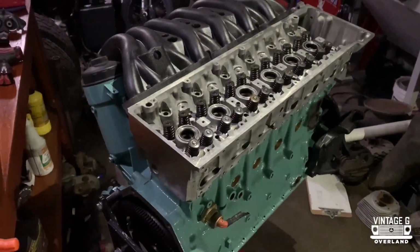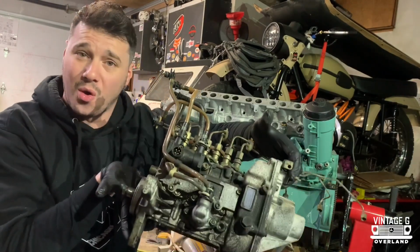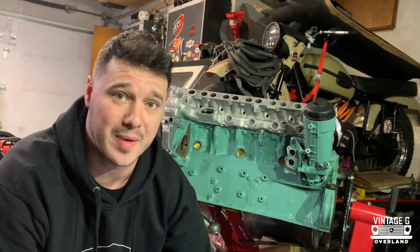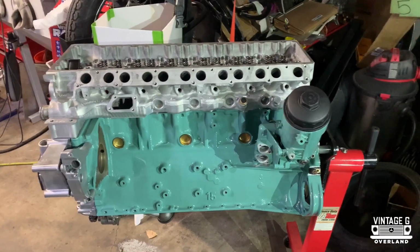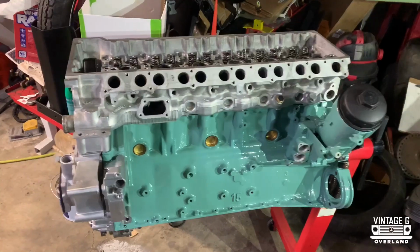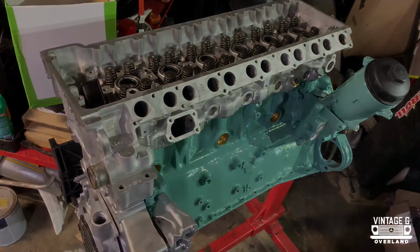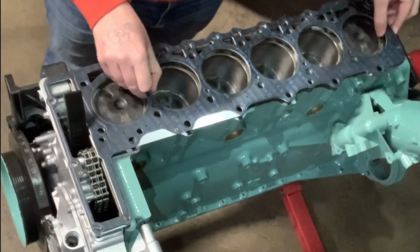Another huge benefit to this engine is that you can actually ditch the old electronic pump and go with a mechanical pump, which allows you to up the horsepower and still maintain about 30 miles a gallon. Once complete, this engine will weigh 463 pounds dry. Now, with the configuration I'm going with, I'm going to stick for a lower horsepower range at around 300 to 400 horsepower, and that should give me just enough juice to travel around the world.